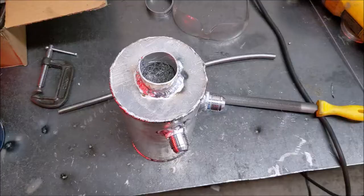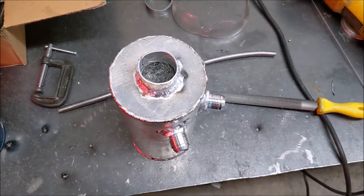I went ahead and packed the steel wool in there. I'm using number three coarse steel wool and just packing it in fairly tight. What I'm going to do is see how the car runs and how much it pushes through. If I still think too much oil vapor is coming out of the breather on top of the can, I can pack in some finer stuff or pack the coarse stuff even tighter — so it's not a big deal, just something to try and adjust.